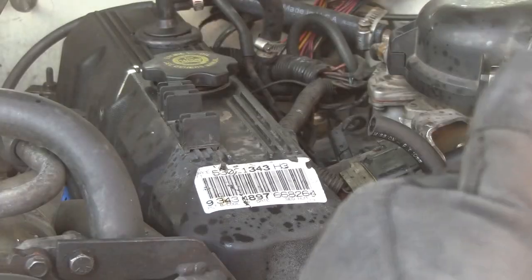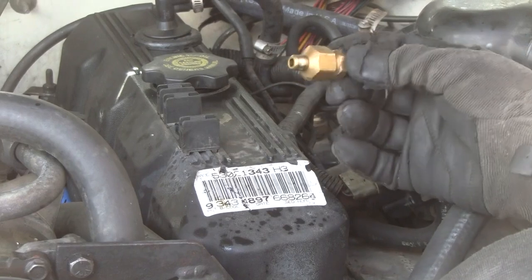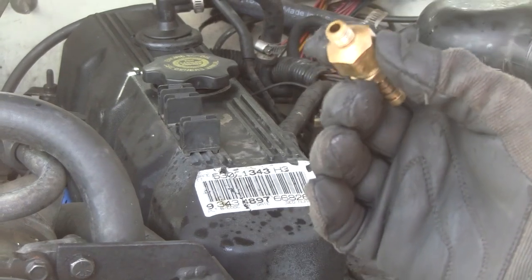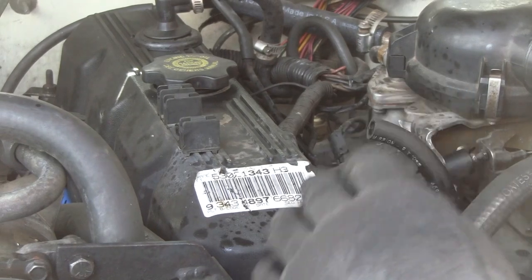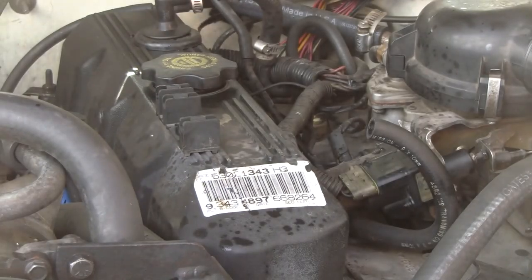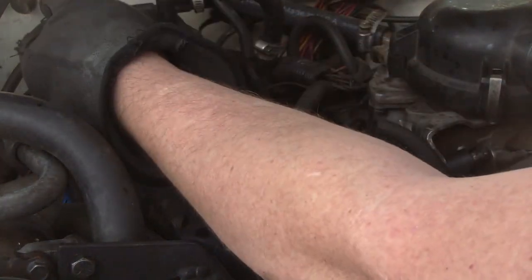Oh, I don't have a second wrench. Anyway, I just took a nice chip out of it. Anyway, this is okay. It fits together and everything, but it's just a massive vacuum leak. Now, part of the reason I discovered this morning, besides the numbers on the scanner kind of giving it away, was I tried to take the cap off. I couldn't physically get the cap off. The vacuum was so strong, it wouldn't let me get the cap off. And I thought, well, okay, the cap's jacked up, it's all dirty, whatever. So I pulled the hose off and the cap popped right off.